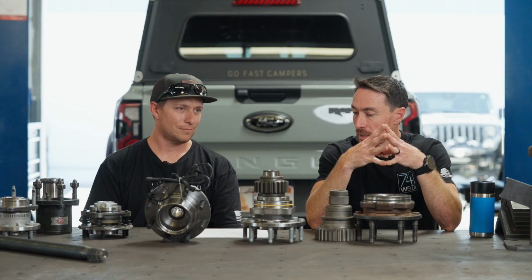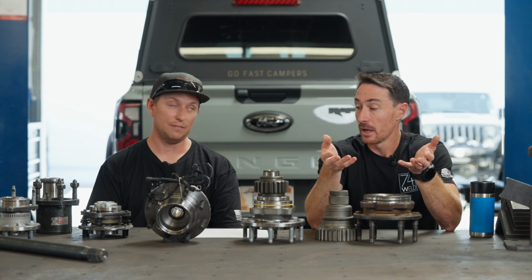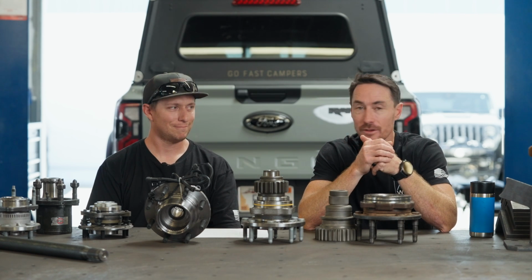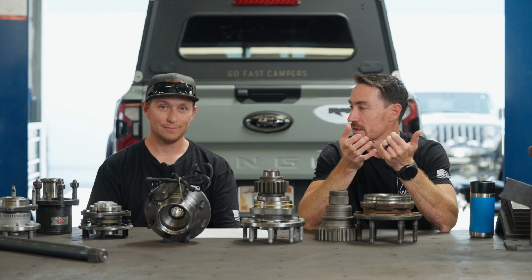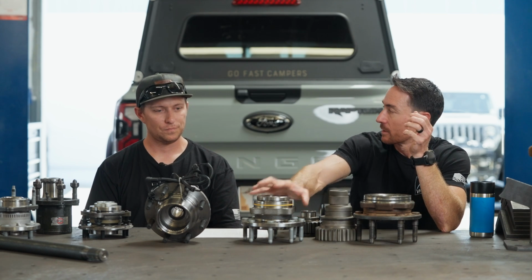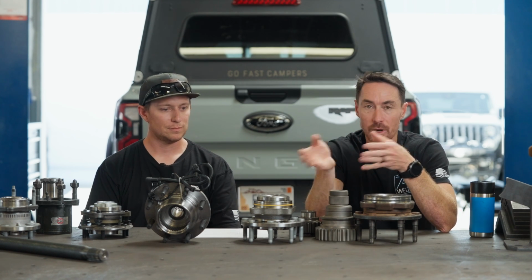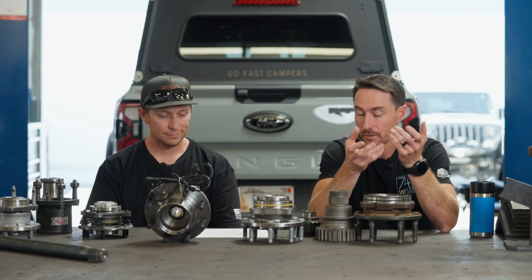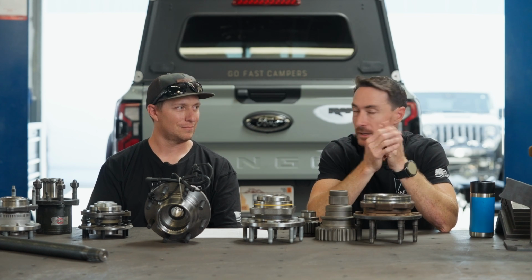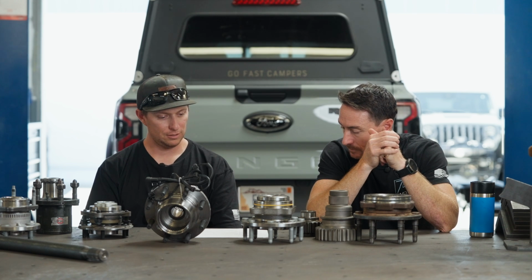The problem with them is doing that in a mass production setting. It's a lot of parts. You have to set it up. And if you've ever done a grease pack spindle yourself, they're messy. And you don't want to be on an assembly line making messy things. They have assembly lines dedicated to just this, and then they can bolt this product on. That's kind of why unit bearings evolved into the market that we have. That's the 2 cents or the history behind it, I guess.